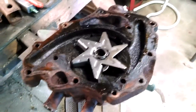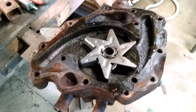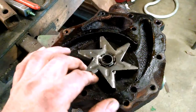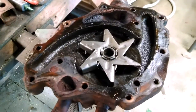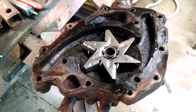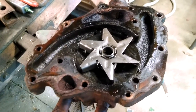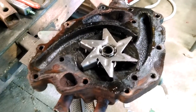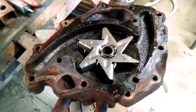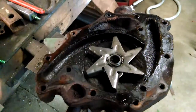This is what the inside of one of these looks like. Sometimes there's a plate on the back, sometimes there isn't — it just depends on the manufacturer. These pumps are pretty similar in design: they all have a bearing, a shaft, and a fan. The fans are usually made out of really good steel and are pretty thick. I did see a few pictures online where the fan was eroded away, but the fluid in those cars looked pretty much like mud.